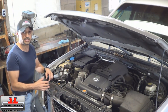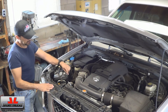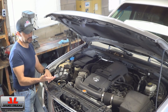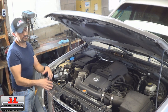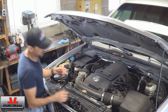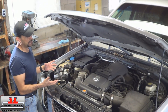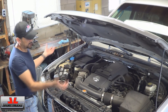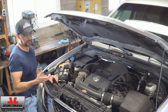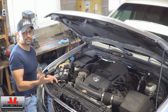That's the whole purpose of this video. One thing I want to point out — if you're concerned about anything shorting out when you're rinsing your engine, you can disconnect the negative battery cable. You can also cover your alternator with a plastic bag if you don't want anything to get on it. Every connector should be sealed with a rubber seal, because engines are made so that if you run into a puddle of water and it gets under the hood, the water shouldn't get in. So unless you use extreme pressure like a pressure washer over 3,000 PSI, by using a garden hose nothing should happen.